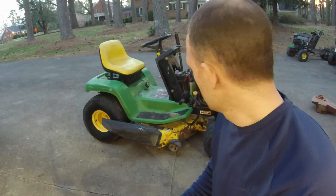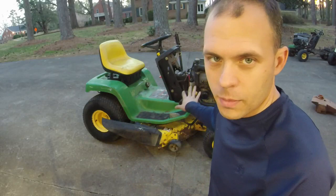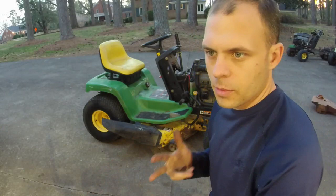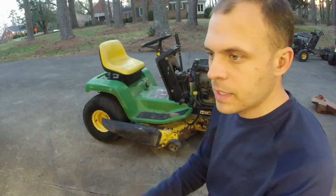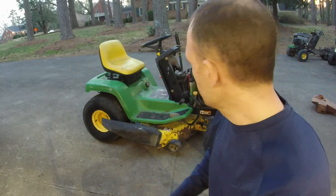When I got this, like I mentioned, I was in the midst of that LX279 that I was having all of the problems with. So I said, okay, I'm gonna go ahead and get a new fuel pump, new carburetor, so I'm not dealing with that anymore. Well, it turns out the new carburetor was leaking over the top in the overflow, and that wasn't good. So what have we done so far? We swapped the tires out, we put a fuel pump on, all new fuel lines, cleaned the fuel tank, put it back together, put a battery in it, and that's about it.